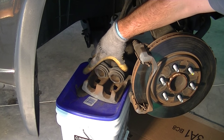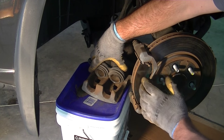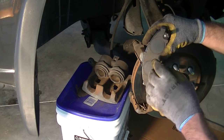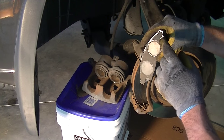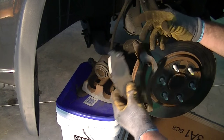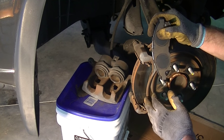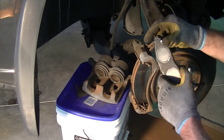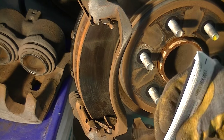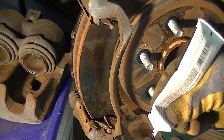Both cylinders are pushed in with enough space for the new pads, so we're going to slap the new pads in and then reassemble the caliper back onto the bracket. Make sure you're putting the right pad on the right side — the one with the big tab goes on the inside on the passenger side of the vehicle. When installing the pads, make sure you put a little bit of grease where they're contacting the actual brackets.